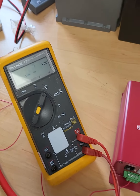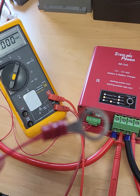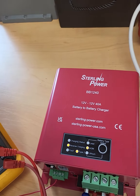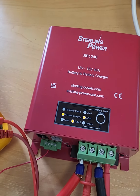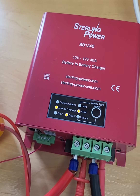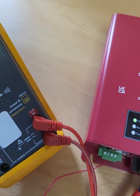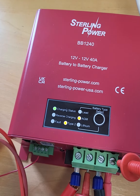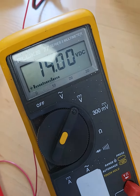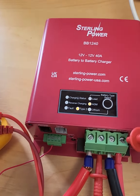One of the beauties with the ignition-fed capability of the battery-to-battery charger is that this is essentially connected to your ignition. I'm just going to mimic it by giving it an independent 12V. So I've just given it 12V now, and the reverse charging LED should turn off straight away — which it's done — and it's reversed the situation to be charging up the leisure battery again, trying to put 14.4V onto the leisure battery, which is what it's trying to do.